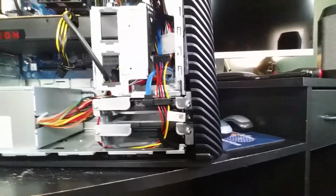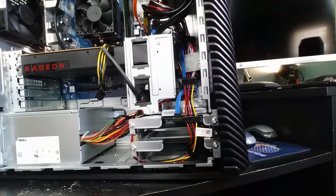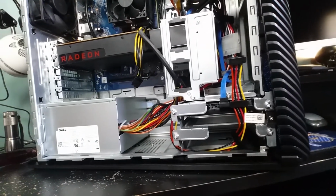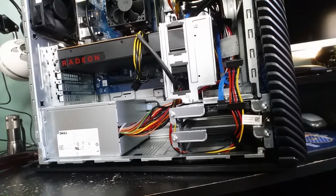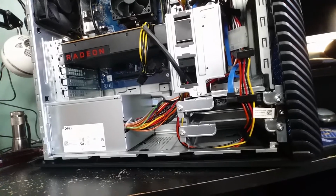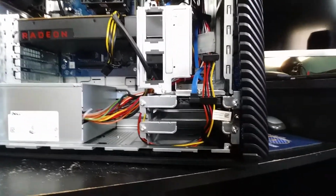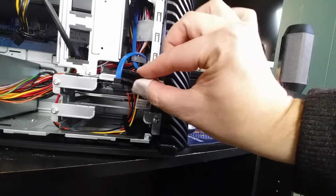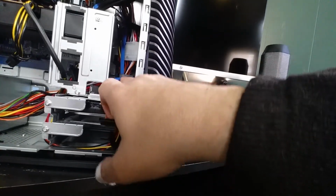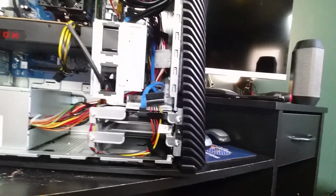And I'm thinking, looking down here now, let's see, what could I do? Well, I've got another drive bay here that I can add my 4 terabytes, so I could leave the 1 terabyte in. I'm not seeing a ready mountable space for my two SSDs, so I'm not 100% sure yet where I'm going to throw those. But what I did with my other computers, I just taped them in place. It was really high tech, you know what I mean? It looks like, I don't know if it's possible, I might be able to put something in here. Oh yeah, there's a slot right there for at least one. So I've got space for at least one. That's cool. And probably could find a spot for another.